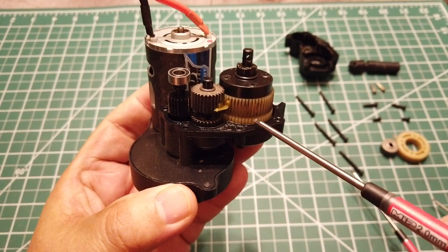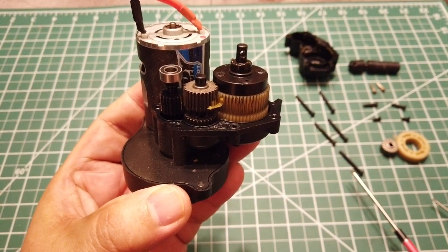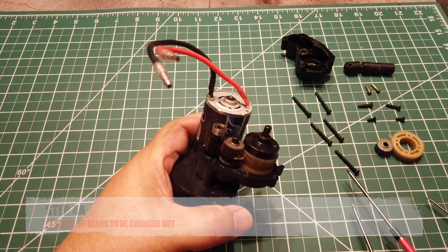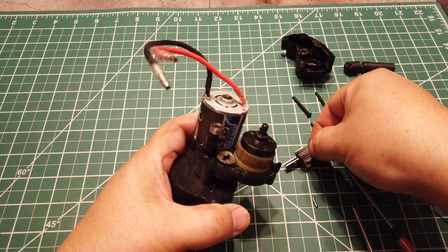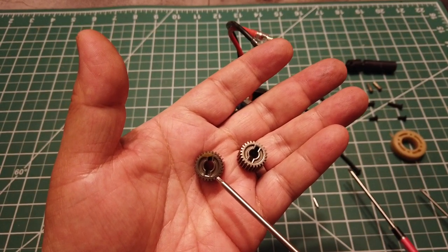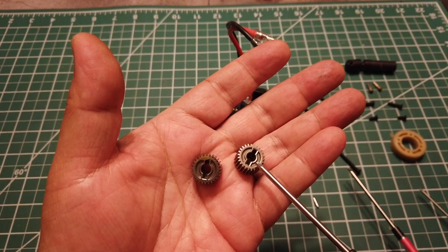We will be changing these two gears to change to 11.83% overdrive. In step 4a, we will remove the gears that will be changed out. We will remove the smaller one first. Here's the 27 teeth one that we took off from the transmission, and we will be replacing it with a 26 tooth gear.